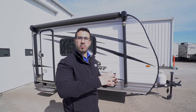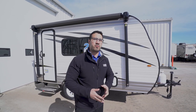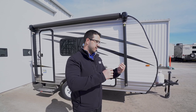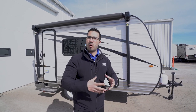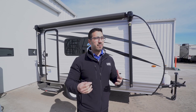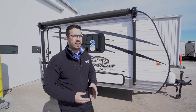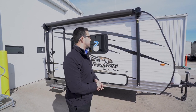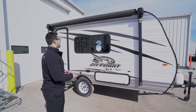One of the great things about Jayco is the Magnum roof system. It's screwed instead of stapled, with two-by-twos for supports and oversized nailing brackets — just a great, extremely strong system overall. They use the Diflex 2 roof on there, which is a fleeceless TPO. What you need to know about that is it has the elasticity that EPDM does, so it's not going to crack when it gets cold, you won't have to worry about hail damage nearly as much because it'll flex, and it doesn't have any of the maintenance that a rubber roof has — you don't have to get up there every year and put additives back into it, which is a huge bonus.